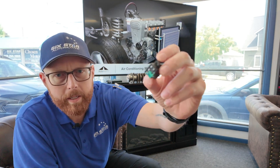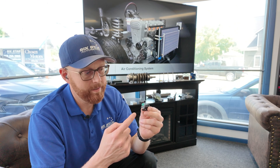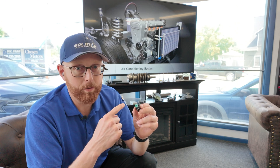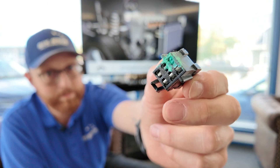One more thing on voltage drop — you're going to find power at the end of the circuit, but it's not going to work. It'll still allow voltage to go through, but it will not allow a load. That's a real-world example of what we're talking about. So do your testing, listen to Scanner Daner, don't be a parts changer. Thanks for watching — I hope I helped you guys out. If you have any questions or requests for other videos, you know where to put them. And remember, you can always come by to experience a six-star difference for yourself.